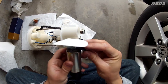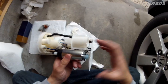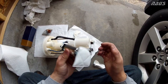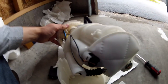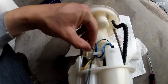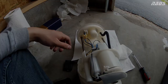Put back on your little rubber protector — it just fits right in there. Now that you've got the new fuel sock on, pretty much just put everything back together in reverse. The assembly fits in there with the fuel sock between the sensor on one side and the fuel pressure regulator on the other side. Reconnect the wire to the fuel pump, pull the wire back through and reconnect it up top. Clean out dirt and debris from the bottom of the cup, snap it back on, and put the unit back in the car.